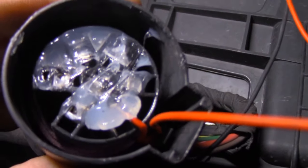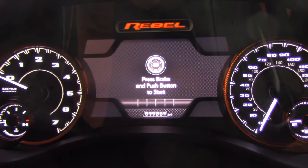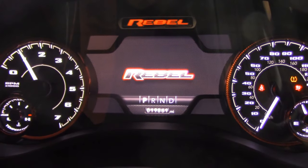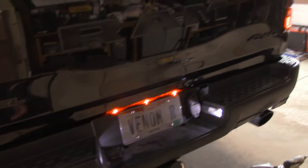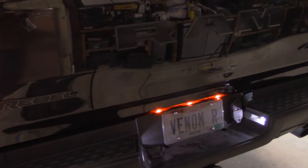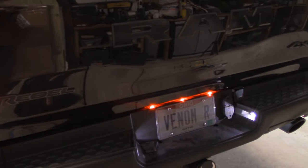There's my dielectric grease — as you can tell I don't really skimp. The wire can come right out right there where this spot is. Let's kick it on and before we put everything back and do our wire management, let's make sure it runs the way we think it does. The lights are on — we're running the way we want them to when the taillights and headlights are on. Now it's time to do some cable management, wire management, and wrap everything up nice. Make sure it's loomed, make sure it's up out of the way.